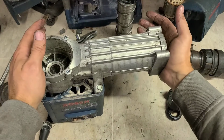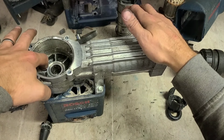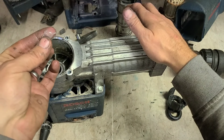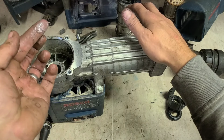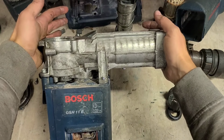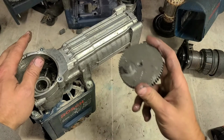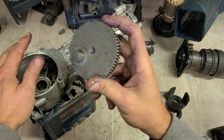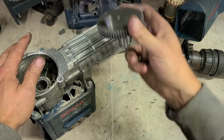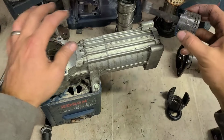I'm going by the amount of grease on this. Somebody has been on this here before, or else put barely anything into it. I don't even know what kind of grease that is actually. It's very light. What to do? I think I'm going to chance putting on a second hand crank and just seeing what it runs like. Obviously, with some new needle bearings.